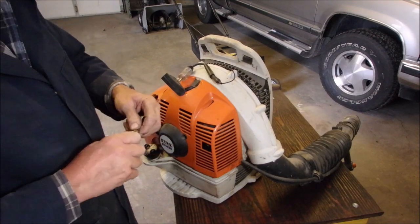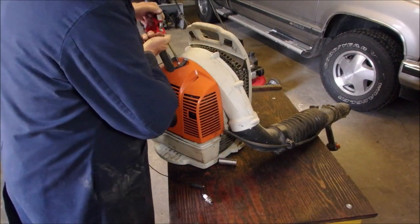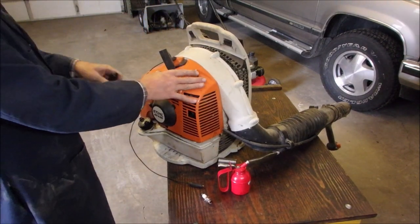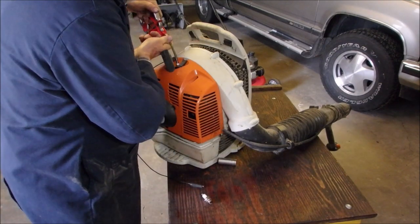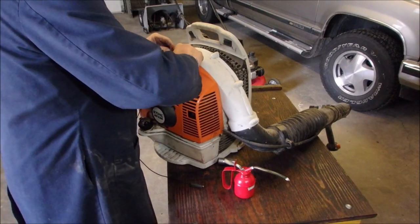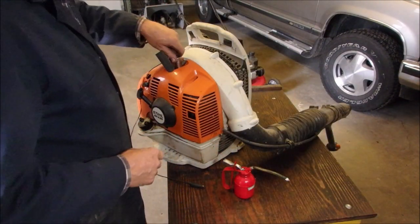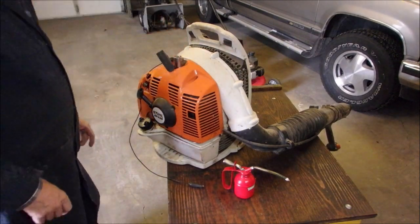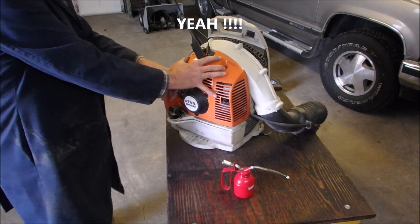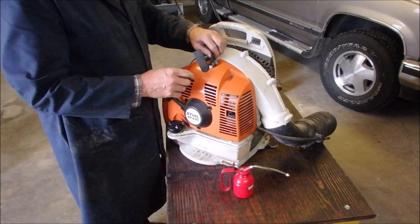Well, it's been used. So now let's just get some two-stroke priming fuel. Stick her in there. 3 or 4 strokes. Rotate it a little bit, get some compression. Put her in there a little more. And put the spark plug back in. And it should fire. You heard it. You saw it first here on BTH-V1 TV.